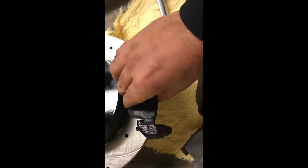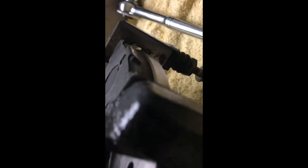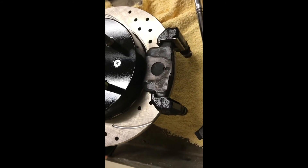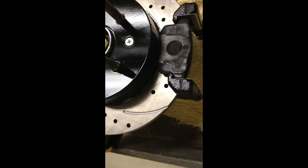Just for comparison, this is an EP3 brake pad — it sits flush against the end and close to the inside. And this is an RSX Type S pad — it also sits close to the end and has good clearance on the inside. The only difference I noticed was the RSX pad was slightly thicker than the EP3.